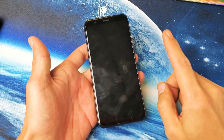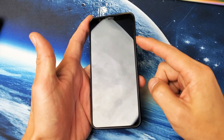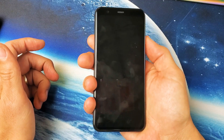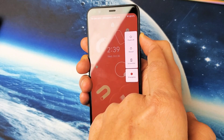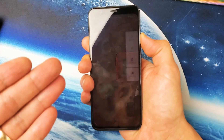Now take note that this phone is actually working. So let's just pretend I have a black screen here and I'm gonna give you several solutions to get you up and running — at least 70% of you guys should be up and running by the end of this video. So the first thing: we're gonna press and hold the power button. Continue to hold — do not let go of that power button until we see the Google logo appear.